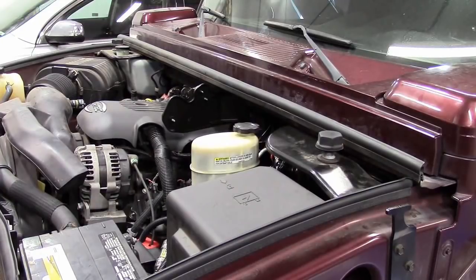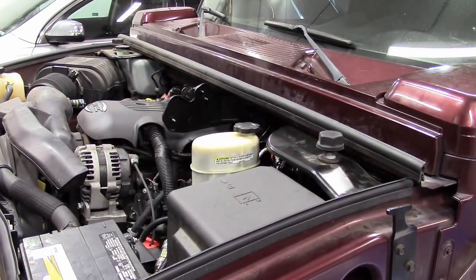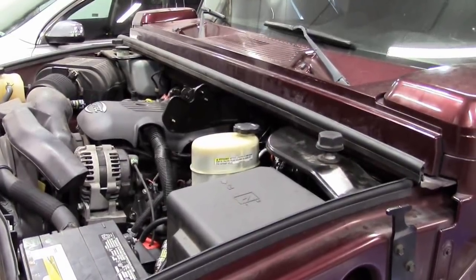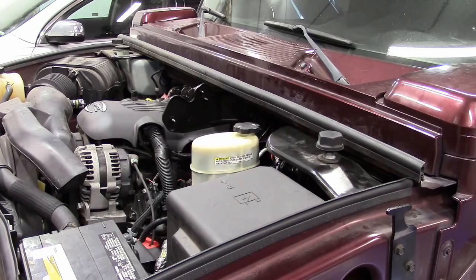A couple of things you can do about that: you can replace the unit, which is what I am going to do, or there's also a rebuild kit available. If you want to save probably a couple hundred bucks, you can rebuild by replacing all the seals in it. I unfortunately will not have time to do that, so I'm just going to be replacing this unit. We're not going to show that — it's just a bunch of bolts spinning. Doesn't take any brains or skill to do that. This diagnosis is very easy — leaking hydro boost unit. Diagnosis is completed.